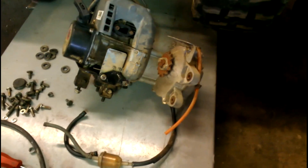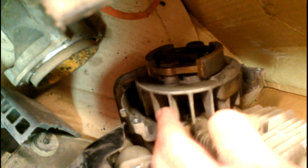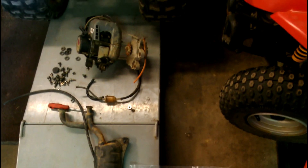So what we did is we got this other motor over here — good compression, doesn't make any noise, no spark though. These motors right here, I guess it's the magneto or the flywheel. The flywheel cover has the coil and all that stuff. We tried this one originally and we didn't get any spark — we just set the motor next to the bike, hooked all the wires up, no spark. We had another one, and that's the one we actually put on it, and when we hooked the wires up it did have spark.